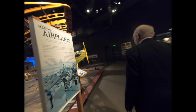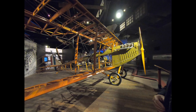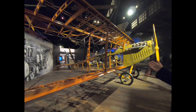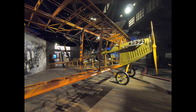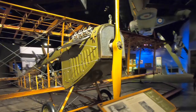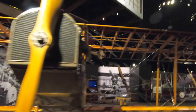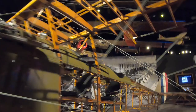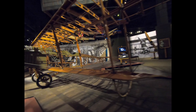You were talking about the barnstormers — the old JN-4 Jenny. We left the fabric off to show people what it looked like in reality. At the end of World War I you could buy one of these for $500 and the engine for $50, and this is what Charles Lindbergh and others taught themselves to fly on — doing the barnstorming around the farms in mid-America. It had the OX5 engine. They found out that by stopping and starting so much between flights, the crankshaft would bend over time — the metallurgy was not up to snuff — so you'd have engine failures from time to time. We made 10,000 of these to train our pilots for World War I and none went overseas.